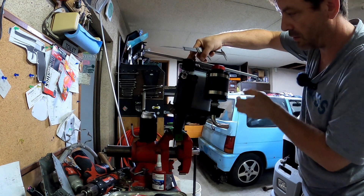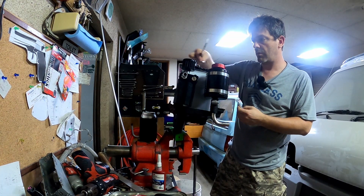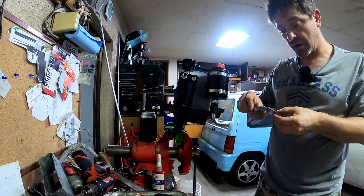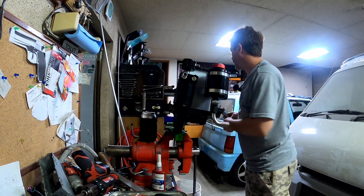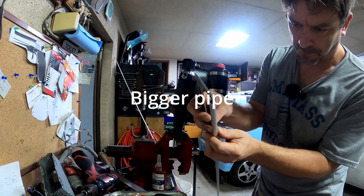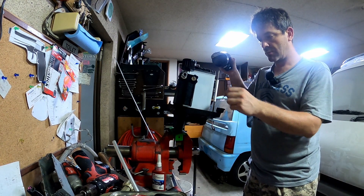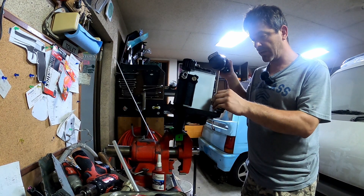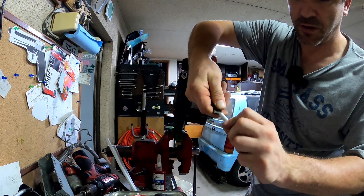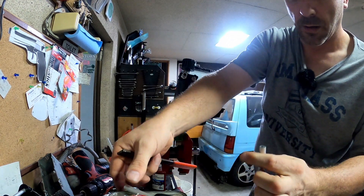Use a piece of flat bar and then we can get it exactly right. Let's call it 10. 10.1 minus — that's exactly 5 mil. So we want to make another rod that's 9.5. I'm going to mark the same on this one. That's a bit wobbly. Let's cut this one. Deburr this one — the other end should be okay, but it's not. Deburr this one. Now the bigger pipe — deburr that.